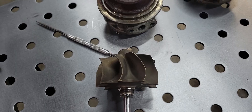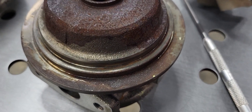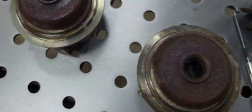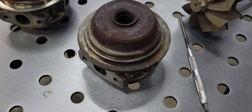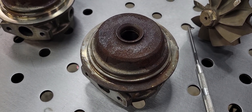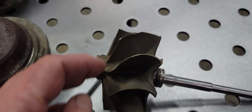It's pretty obvious just because of the moisture and the buildup on this one, and the flange not being clean all the way around compared to the second one. This turbo had a problem where it was not centered in the housing, allowing exhaust gas and condensation to escape out of it — and unfortunately allowing the turbine wheel to contact the turbine housing in the process.